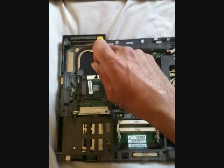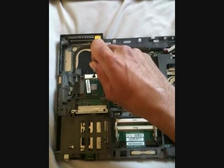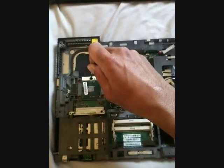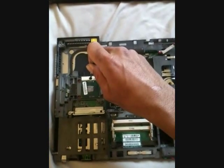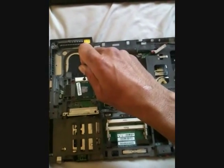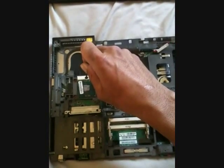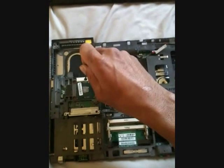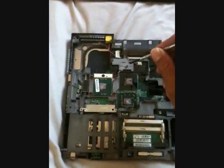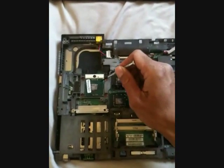Remove the CPU by turning this screw counterclockwise. When putting it back on, make sure the screwdriver slot is parallel to the CPU edge. Sometimes this screw gets stuck midway and gives a false assumption that it's already fully seated — you have to force it all the way to its locking position. This is a common problem because one would think the CPU is fragile, being the brain of the system, so you would be afraid to force the screw and ruin the CPU. Also, when putting the CPU back on, use these two triangles as position guide markers.